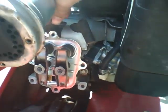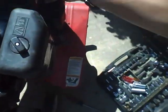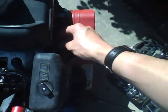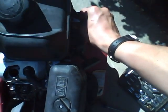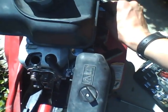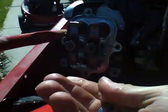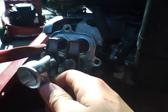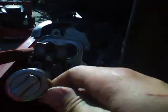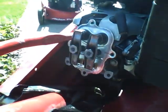It's got compression! Let's go figure that one out. Got no muffler on it right now, so I'm just going to see if it'll fire off and start. There we go — she's fixed! That's all the problem it was: the valves. They were too dang tight. I'm going to go just a little bit more. Sweet. So let's reassemble her and start her up.